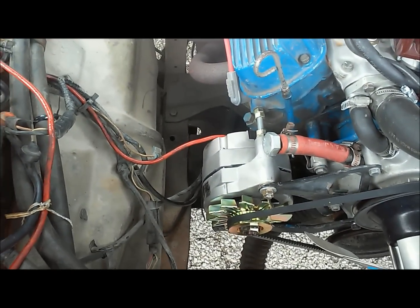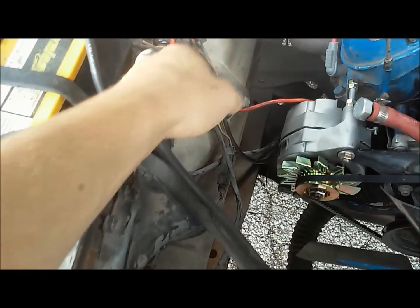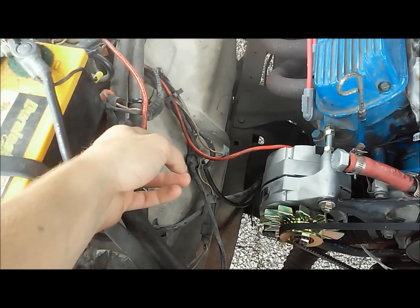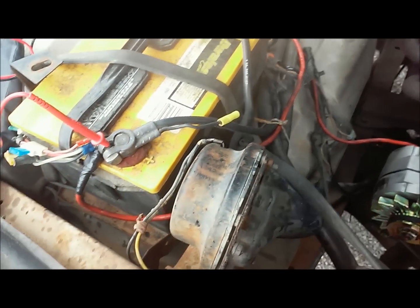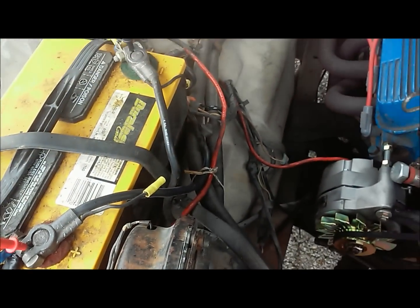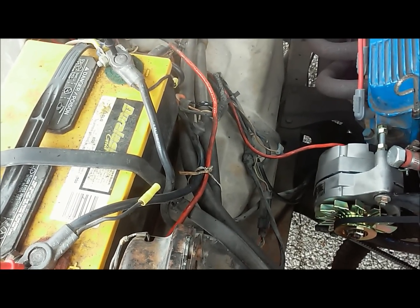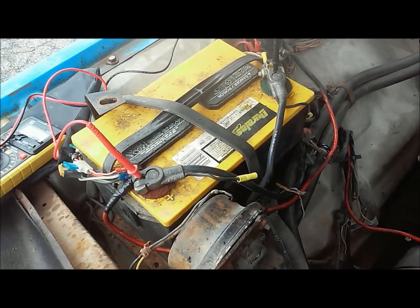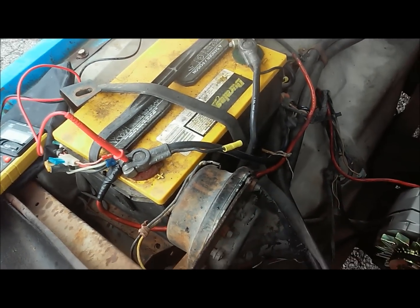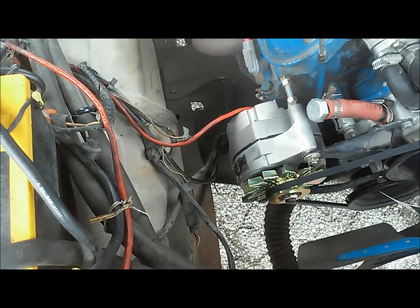What I also don't like about it is, you have a voltage drop through this wire. Now, depending on how long this wire is and the gauge of this wire, it'll determine your output voltage. So I got an 8 gauge wire, and we can see that it's a little high, like 14.5. And maybe a 10 gauge wire would work, I'm not sure. I'm going to test it like this, and if something goes wrong, I'll do an update video if it fries my battery. But from my research, it should have an 8 gauge wire on it.